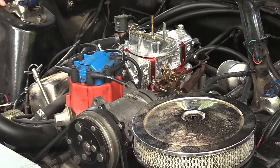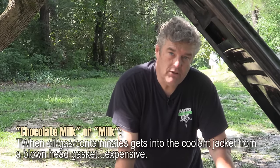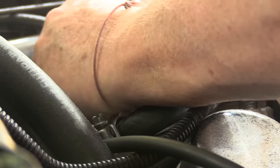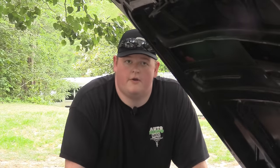We're going to shut it down and start working on the timing. I want to talk briefly about vacuum tuning. With a car like this you want to find manifold vacuum — usually there's a vacuum tree on it. Unplug or uncap a line and plug your vacuum gauge into that port. Some early engines, like the Buick Nailhead V8, have no vacuum ports on the intake manifold at all — in that case I'd go after a timing light tune instead. I personally prefer tuning with a vacuum gauge, which is why we're doing this today, but you can also do it with a timing light or even by ear.